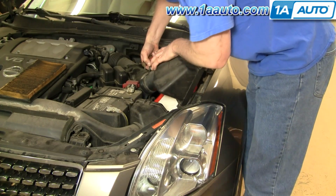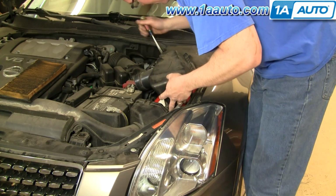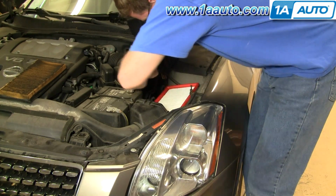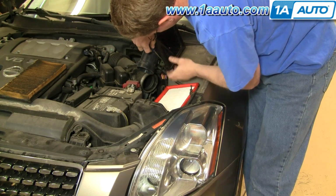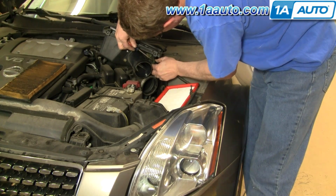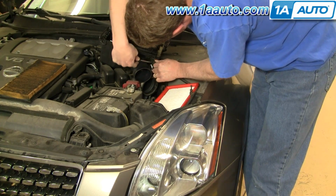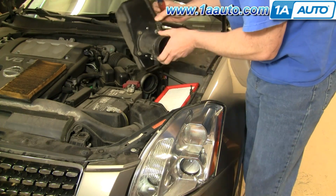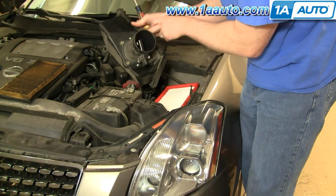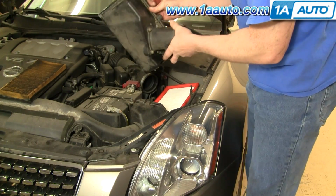Okay, now disconnect it right here. Just a little clamp here holding the harness on. I'm just pushing the teeth, collapsing the teeth and pushing the wire harness back through. Okay. And now my airbox is fine, so I'm going to put my original one back in. But what you would want to do is remove these four 10 millimeter bolts and take your airflow sensor housing and bolt it onto your new one.